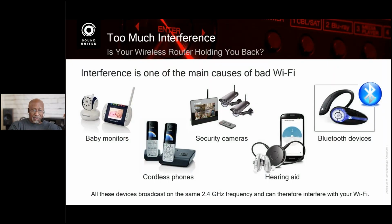But now basically what's happening is you have all of this madness going on with 2.4 in your house, with the microwave, security cameras, all of this stuff, plus your laptops and everything else. And then you put a 2.4 mesh network on top of this. You're just throwing a ton of different wireless interference at each other. Our systems utilize the backbone of your Wi-Fi network, which, number one, eliminates having an additional 2.4 mesh network. And if I need better coverage, I just increase my Wi-Fi system, and my entire Denon Home HEOS ecosystem gets better.